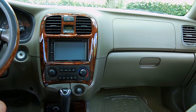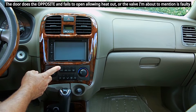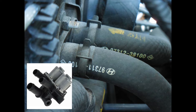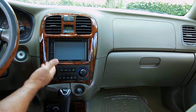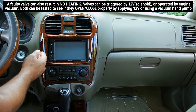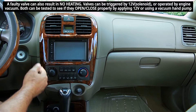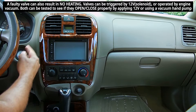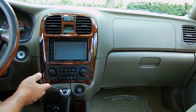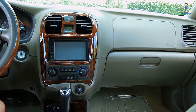The information in this video can also be used to troubleshoot no heat in your vehicle. Besides the blend door, some vehicles have underneath the hood, where you see the two hoses going into the firewall for the heater core, a heat control valve. It regulates how much hot coolant goes into the heater core behind the dash. If that valve is faulty and set to cold, the coolant should be at a minimum restricted or shut off. When set to hot, the valve opens the flow of coolant through the heater core. So there are really only two problems: the blend door is most common, but you can also have a faulty heater control valve.